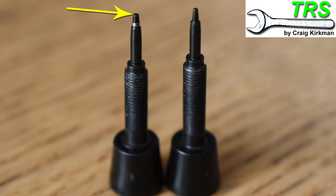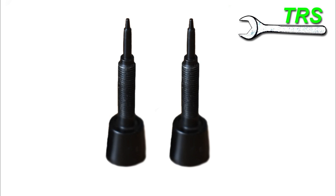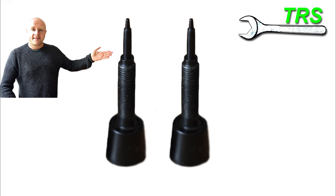So it's a case of seeking out whatever distinguishing features you can possibly find about the fuel screws and then matching them with the fuel screw holes inside the carburetor — it's as simple as that. And if the two fuel screws are exactly the same with no distinguishing features, then it certainly won't matter which hole they go in. This process might not seem easy and straightforward, but remember this is possibly a last attempt to try and get your carburetor up and running again if you've mixed up your fuel screws. I hope you like it — please like and subscribe, and I'll be back soon. Thank you for watching.